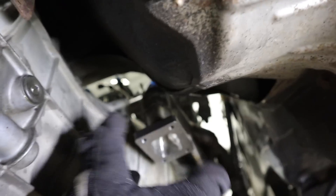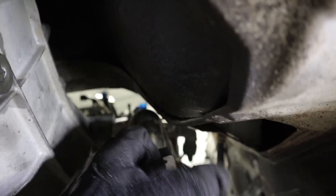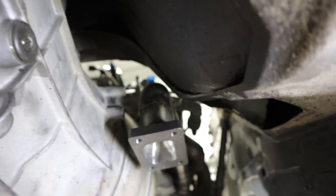Now we're underneath the car. I think the best idea is to have a pipe come off here and sort of come back this way, and just have the wastegate somewhere around here. I'm going to cut some pipe that's the right size, notch it so it fits around this tube, and then we'll see where we are.